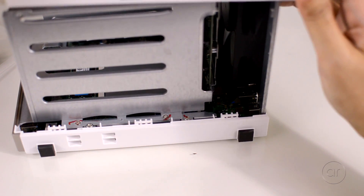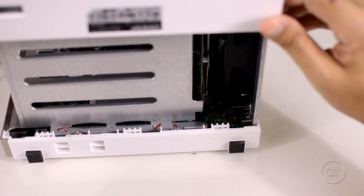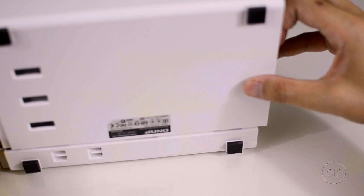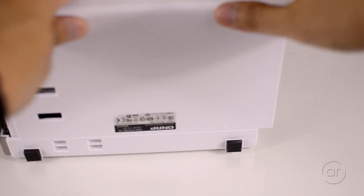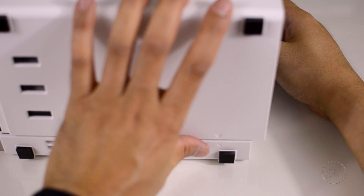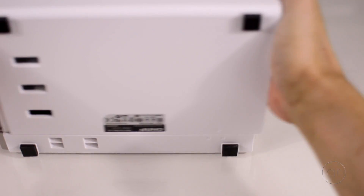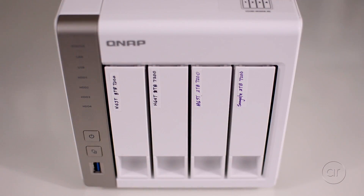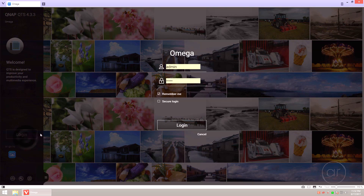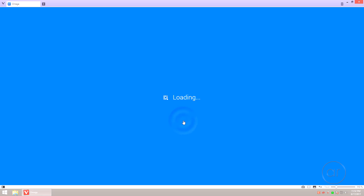From this view, where we're looking at the bottom of the case, all you have to do is place the plastic shell onto the bottom piece, but as you do so, make sure that the small triangles on each piece line up. Then you just slide the two parts together until you hear a click. After you insert your hard drive caddies into place, let's start up the server and go back into the QTS operating system and confirm that our memory upgrade took.